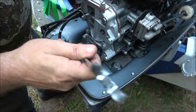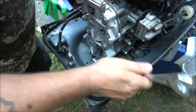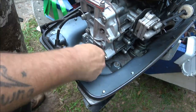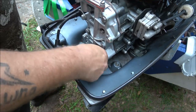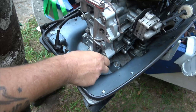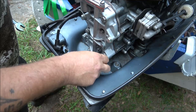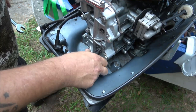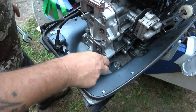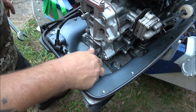We're all the way to the end of the threads — I'm not going to go any further. I don't want to go so far that I have trouble getting this threaded back out. It should come out nice and easy, then we're ready for the insert. I need to go find my Loctite. All those thread cuttings — I kept wiping it off as I went, so there'll be even less.